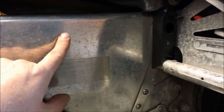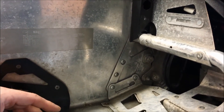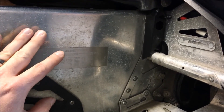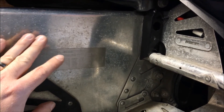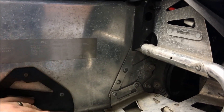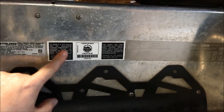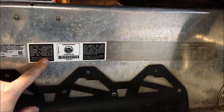This is the tunnel, and all of this pitting you see is not dirt — I've already washed the sled before bringing it in. This is all corrosion from road salt, brine, and ice-melt products. This is one of the drawbacks of having a bare aluminum tunnel because it's always a maintenance item. Before we start, we'll cover the decals with masking tape so we don't affect them.